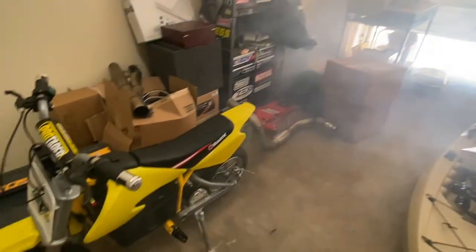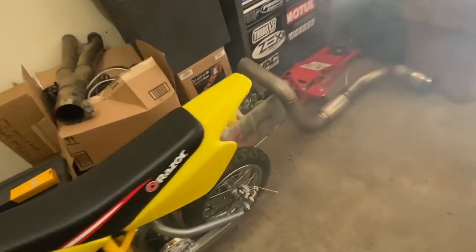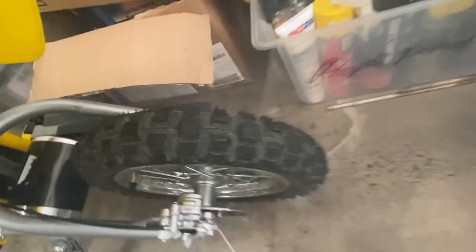Well, it works. So that's how you do it. That's how you switch the cables left and right, tighten up the tension and deactivate the safety switch. So now you can use that left hand to hold the front down in place while you use the right hand to slam it on full throttle and do a burnout, or just skid around a corner if you're in some gravel.